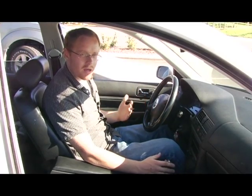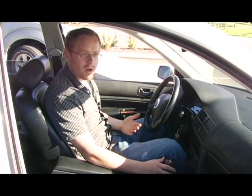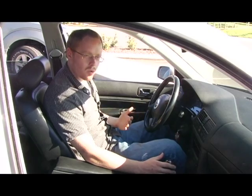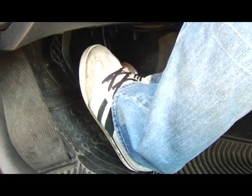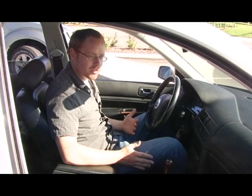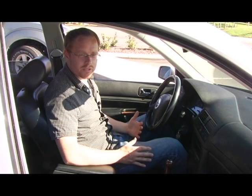The hard part about driving a manual transmission is learning to balance engine power, or your throttle, from your right foot to how much you're letting out with your left foot, which is the clutch. So you're going to slowly pull your left foot out to allow that power transfer to engage to the transmission. If you let out too swiftly, you're going to either peel out or burn the tires out, or you're just going to simply stall the engine because the engine doesn't have enough power to actually get the vehicle going. Getting the vehicle going is the hardest part about manual transmissions.